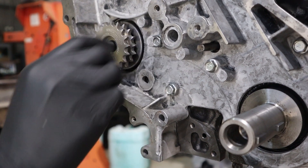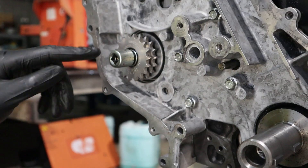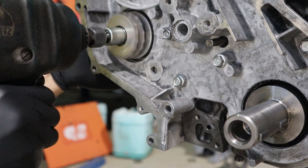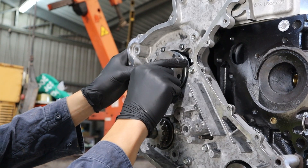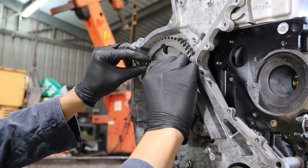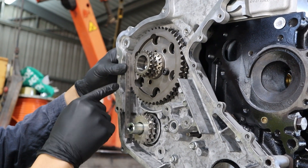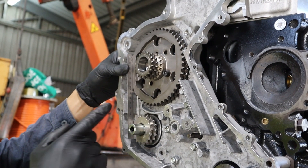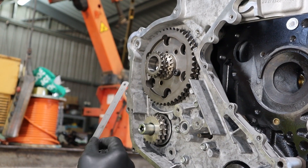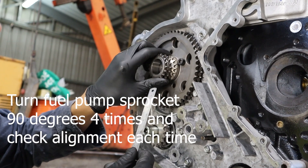Install the vacuum pump sprocket, the black flat washer, the spring washer, then put some Loctite on the threads and nut and tighten to 55 newton metres. Install the fuel pump shim and the fuel pump sprocket with two screws. Use a straight edge to check alignment between the fuel pump sprocket and the vacuum pump sprocket — this one is straight with a 1.15mm shim. If yours is out of alignment, use another shim from the shim kit. Also spin it around a couple of spots to check for run-out in the fuel pump.